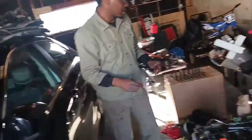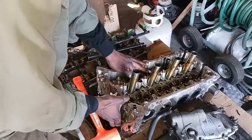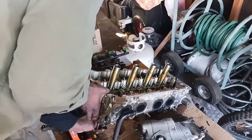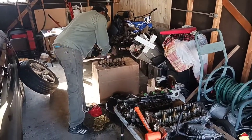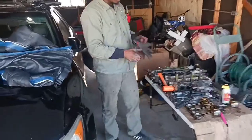The reason we're pulling them out is because we want to clean them — very high carbon buildup, as you can see. Not too bad on the back side on these exhaust valves, but when you look at the intake side, you can see very bad carbon buildup. We're going to thoroughly clean everything as well as the head. I'm also going to be doing a video on removing the lifters — it's pretty simple, just pulling them up — but I'll make a dedicated video showing that in more depth and how we get everything ready for cleaning. Y'all want to be careful with this — sharp edges. I really should be doing this with gloves, so let me put my gloves on.